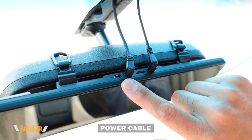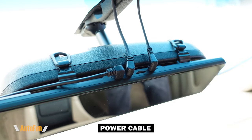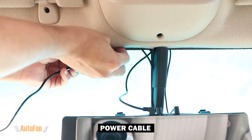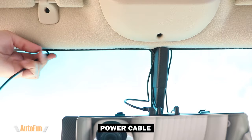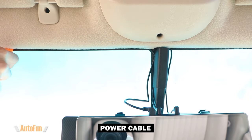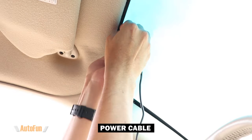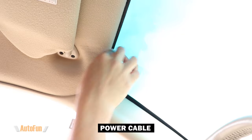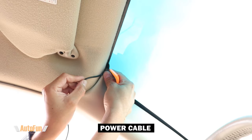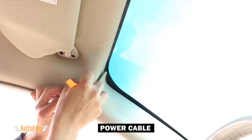I'm moving over to the power cable, which connects in here. I'll feed it in the direction of the driver's side using the same techniques — my fingers and the spatula where needed — to make sure it's fully bottomed out. As I get closer towards the A-pillar, the same thing happens as with the rear camera cable: I may potentially encounter an airbag. This particular car does not have an airbag over this area, so I'll continue and feed the cable into the A-pillar without any issues.